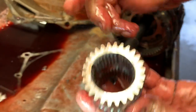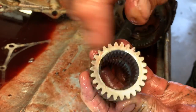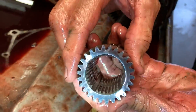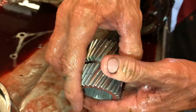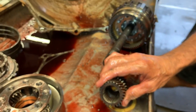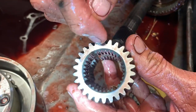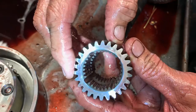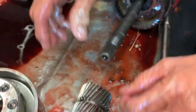Same way with your sun gear — if you notice, this sun gear has four grooves in it. That's for the rear oil from that cooler line to go through and lubricate forward through the tranny. The 400s have two grooves, the early 4L80Es have two grooves, but the rear cooler line style has four grooves. So when you go changing bearings and swapping parts, that rear cooler line configuration really comes into effect in a big way.